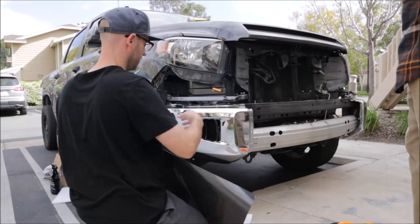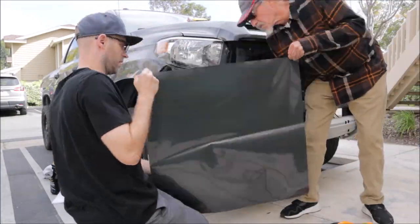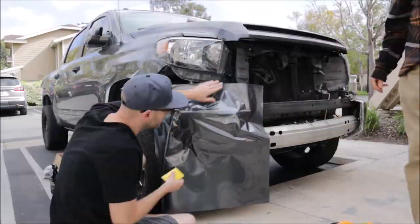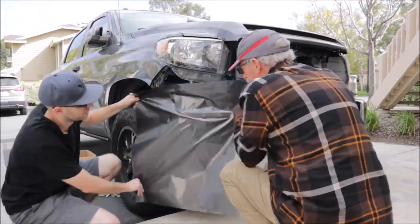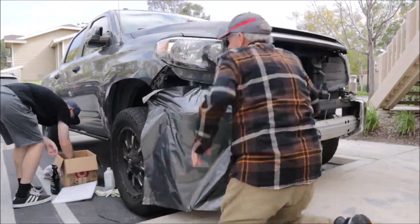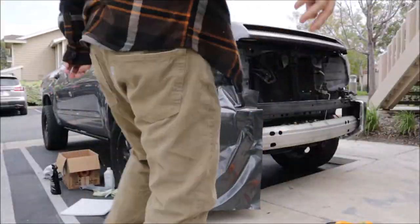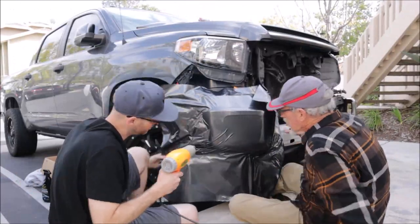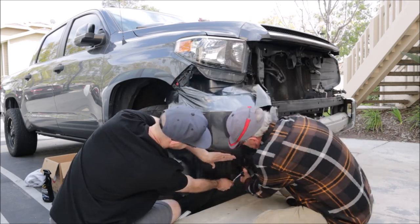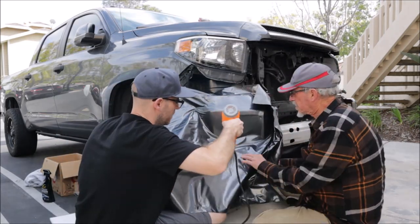What I just did was bad. Ripping that front bumper off was a big mistake — I thought I had everything detached, but I didn't. The first few attempts at wrapping the front corner pieces was very discouraging. Me and my dad — pops still helping — got the front bumper corner almost completely wrapped the first time and I didn't think it was that hard. But we added too much heat, got too close with the heat gun, and it tore right through the vinyl. So that one was a waste.